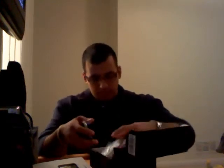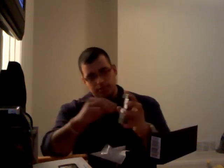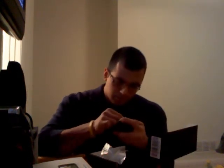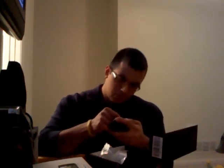Here we've got all the contents that come with the phone. Pop off the back battery door cover and remove the battery. The Verizon card comes inside of it when you purchase these brand new, so you're going to want to remove that and insert the T-Mobile SIM card.